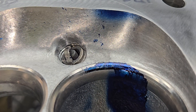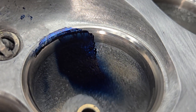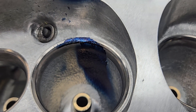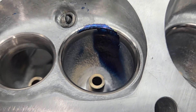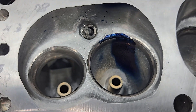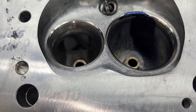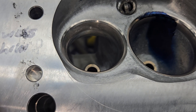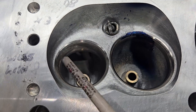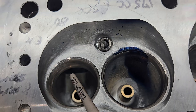Not nearly as much chunkiness on it as we had before. We do have a couple of splatters, and we got a nice hit on that edge of the chamber. The chamber is pretty much finished - I did what I could on the edge. Remember when you do it, you can't go over where the gasket lays. The gasket lays right against this all the way to about here. Same thing with the exhaust - you're able to just round it a little bit. In the chamber, we took care of around the plug to decrease detonation and brought down the angle for flow through the exhaust.